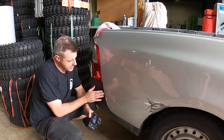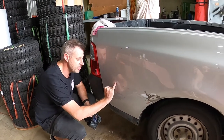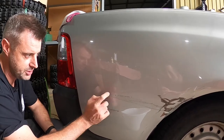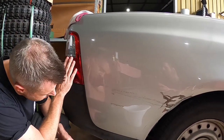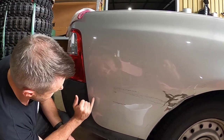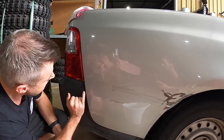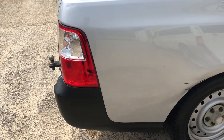So I ended up just giving it another quick going over with the finishing paste. You can just see a little bit of a dull section here, and that's purely because I haven't gone full strength around here — I didn't want to remove the original scratches so we can get before and after. But with that second hit of the finisher, the finish on this side is much more glossy than what we've got over here. It's really cleaned the paint quite nicely, and when we do the whole panel it's going to be a big change.